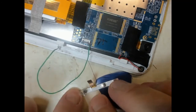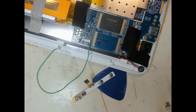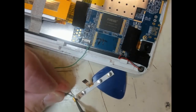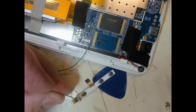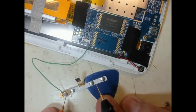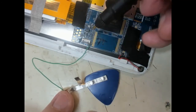See if we can attach this wire with a little bit of the self-adhesive that's on there. Let's get around the back end of this connection and put it on there, shall we? Reset switch. And yeah, that looks like a good connection. And again, check continuity between the outer part of that reset switch and that pin, which it is making.